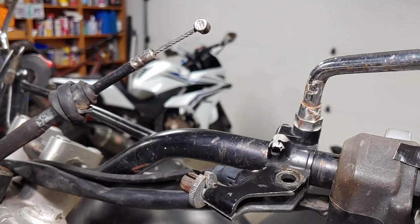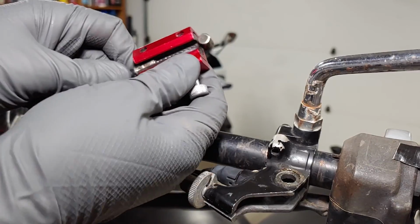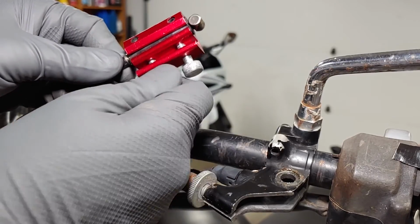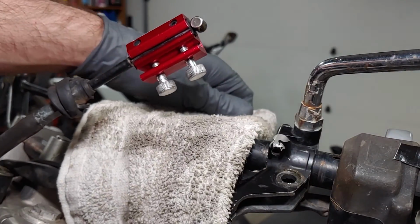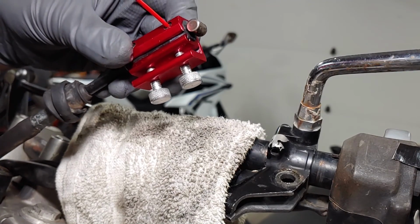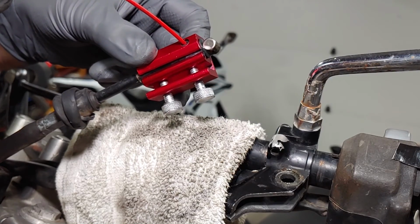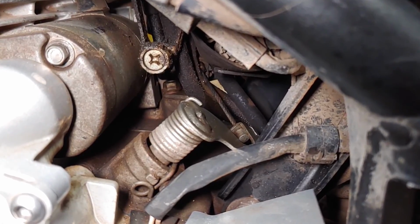This is a good time to lube the clutch cable, which should be done once a year. The inside of the luber tool gets narrower from one end to the other, so only insert the cable housing until it has a good fit. Lay down a rag to catch any drips, and slowly spray your favorite cable or chain lube into the tool until clean lube starts coming out from the other end of the cable. If the cable is rusted or damaged, it should be replaced.